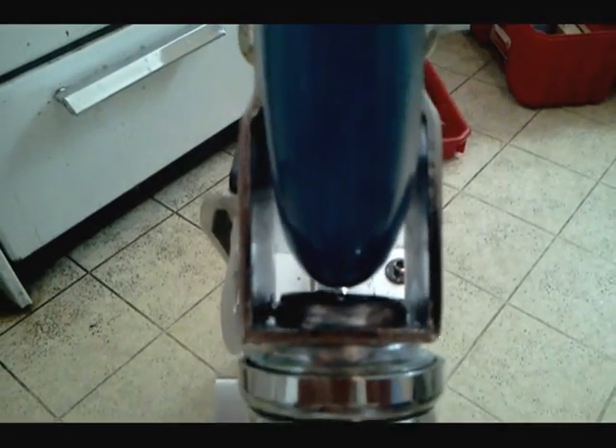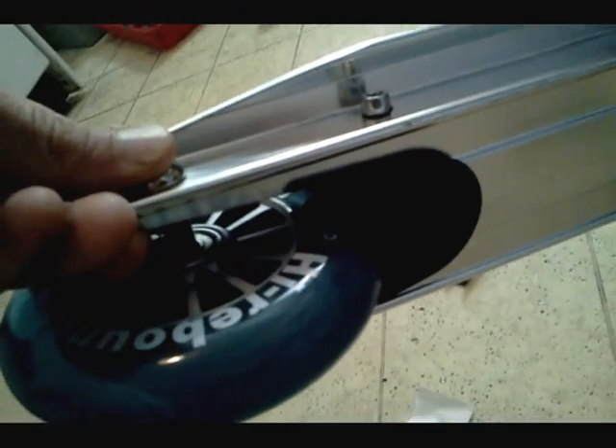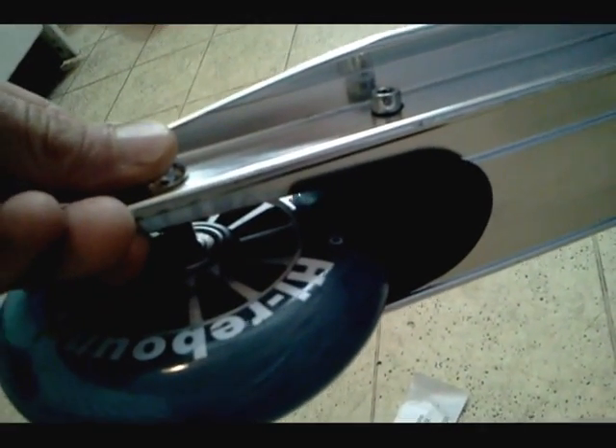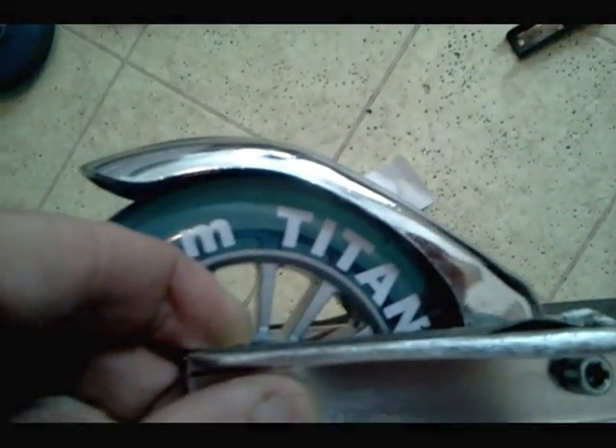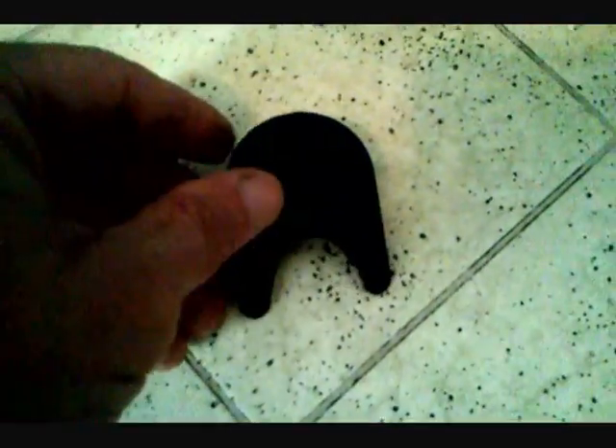The problem is that black piece of plastic is running up against the wheel. The brake I'll be able to adjust higher, but right now it's hitting the wheel. What the black plastic piece does is supposedly prevent dirt from getting up into the brake spring, but it's still really gunked up with dirt anyway. So what I'm going to do is cut away in here to accommodate the wheel.